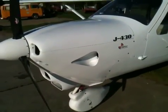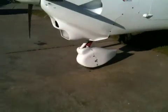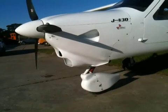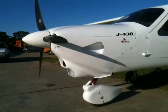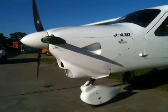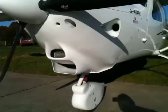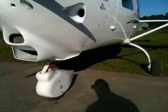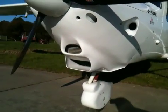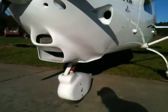What we've done here is use a genuine stock standard cowling. All we've added is a scoop at the bottom, just under the oil cooler scoop. Inside that scoop there's a small motorcycle radiator — about 175 by 200mm, smaller than a sheet of A4 paper — with a core thickness of about 30mm. The radiator lays flat in the cowl with a diffuser at the back. Air comes in through the lower scoop, feeds through the motorcycle radiator, and exits near the low-pressure area by the nose wheel.